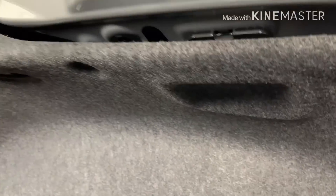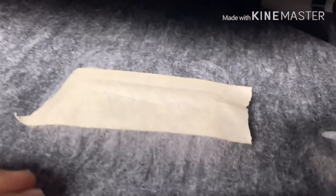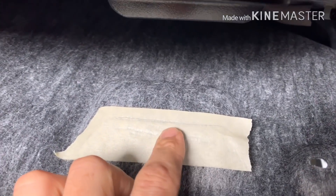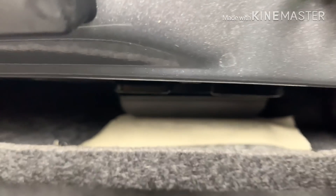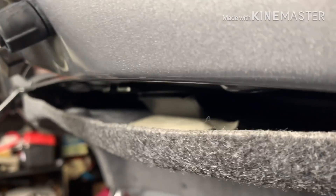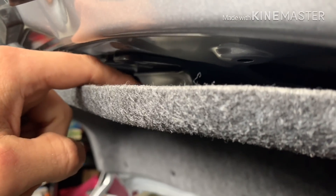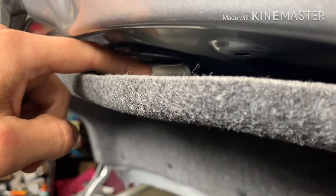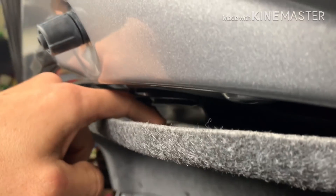I got a piece of masking tape and made a pencil line — I can see it but the camera doesn't pick it up much. That's the mark where it lines up. If I cut it there where the scribe is, you can see the handle is at an angle. Where this piece comes down is probably a quarter inch further up, so that's where you're going to want to cut.